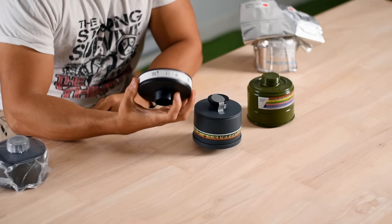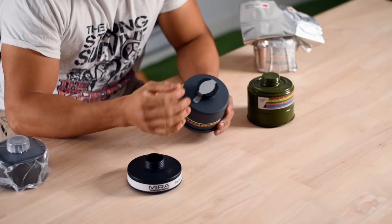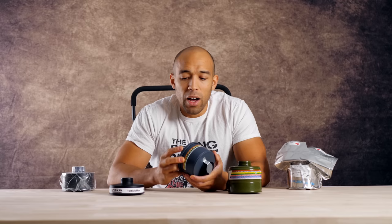A lot of people want to know about shelf life. The shelf life of a HEPA filter lasts basically until the paper becomes brittle — probably around five to ten years, possibly longer if you store it in a vacuum sealed bag. Just like food, what causes it to expire faster is wild temperature extremes and exposure to moisture and oxygen. So if you can keep it in an oxygen-free, moisture-free, cold dry place where the temperature is constant, it's going to last a long time. The activated carbon is not going to expire easily, but if there's oxygen getting in and it's not a perfect seal, it could be intaking background chemicals and gases, which could eventually cause the filter to expire.